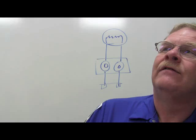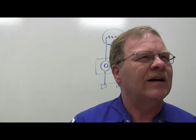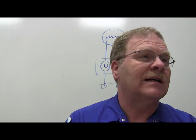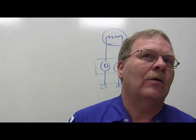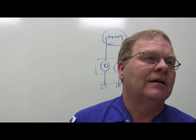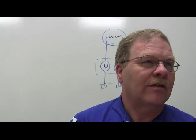And so the point is, listen, if you're working on a drivability problem and it's giving you some fits because you can't figure out what's going on, what you need to do is recognize the fact that you need to test your fuel. And at the very least, if you can figure out a way to put a sample of really good, known good fuel through that thing under pressure, and there's ways you can do that if you're a thinking man, and it runs good on that.